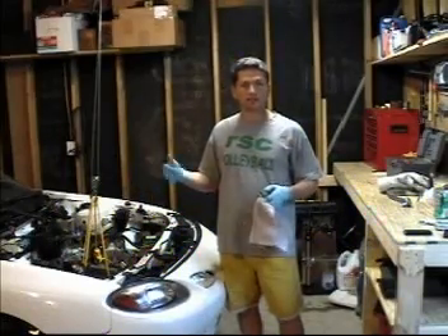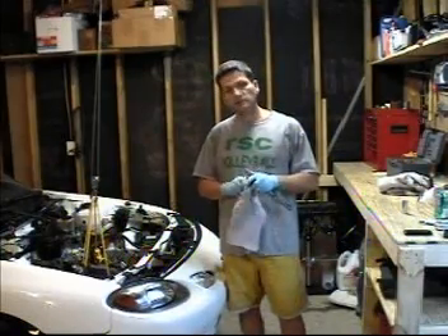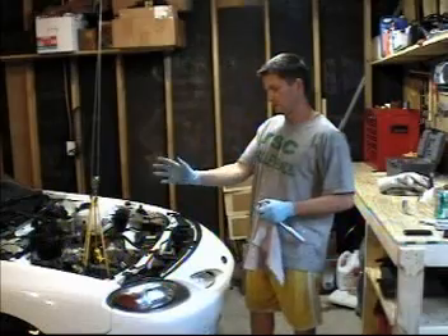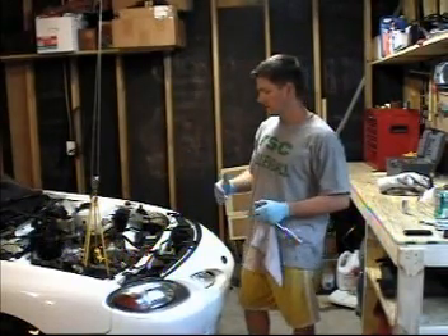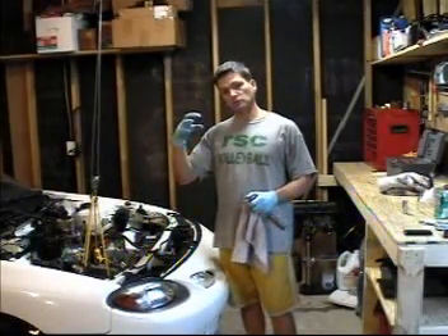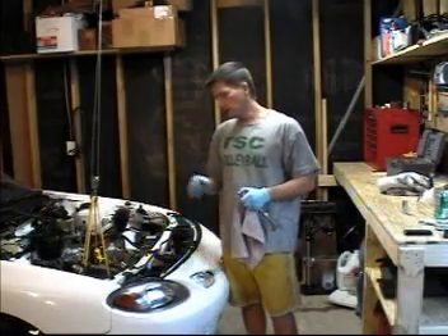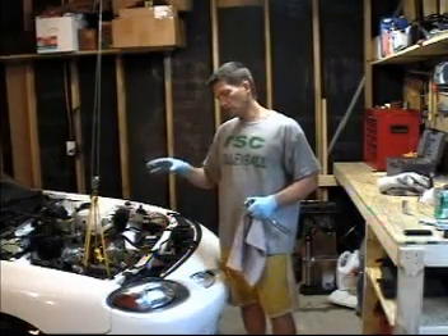This part is all finished except for one important thing: the passenger side motor mount had to be removed, obviously, because there's no engine there for it to mount to. So we're going to have to have a custom motor mount fabricated to hold the end of the motor to the frame rails. The passenger drive axle also has a mount that used to mount to the engine block, and that's going to have to be incorporated into that mount as well.